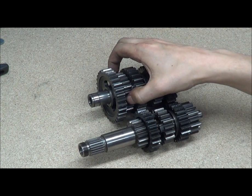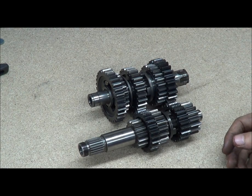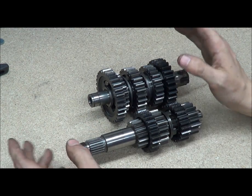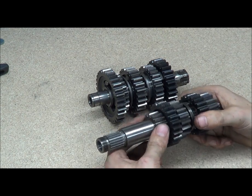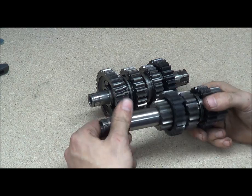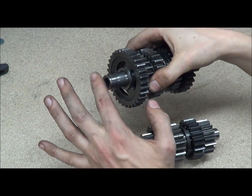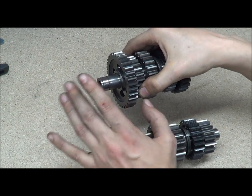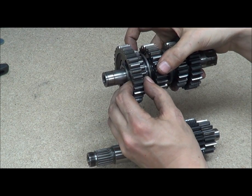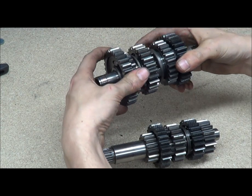Trying to work out which gear to move where — because we have these moveable gears and they are meant to move on purpose. In this case we have three; most bikes you have three. So basically the way it works is: you want to engage first gear. You imagine this shaft's turning, that means number one gear here is turning with the input shaft. So when you rev the engine, this shaft rotates, this gear rotates. But it hits this gear and this gear just freewheels. So your output shaft, your rear wheel, does nothing. It's only when you select first gear that this moveable gear moves and locks into this gear — and now when I turn it, it's solid and the whole thing turns.